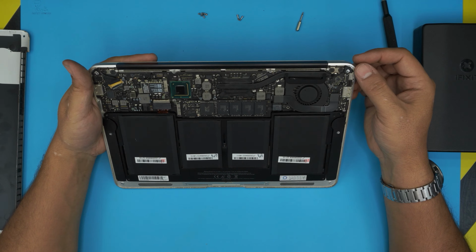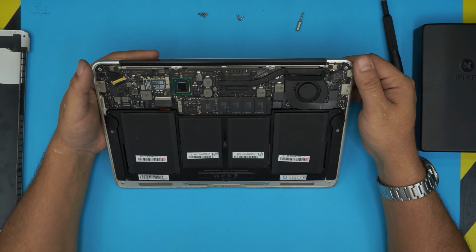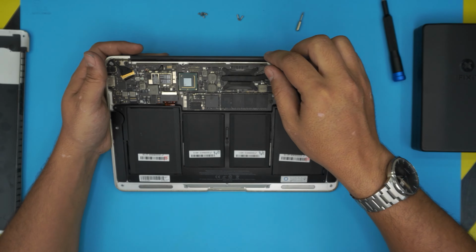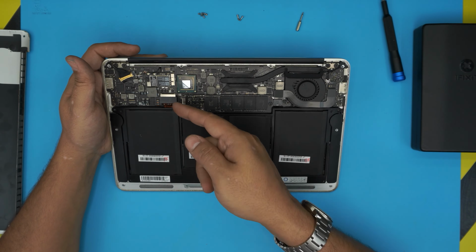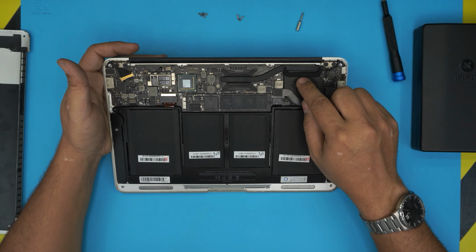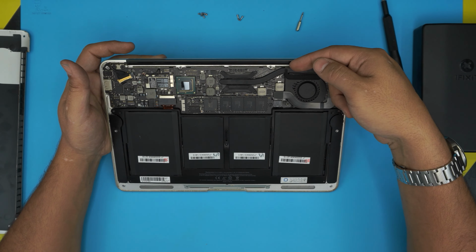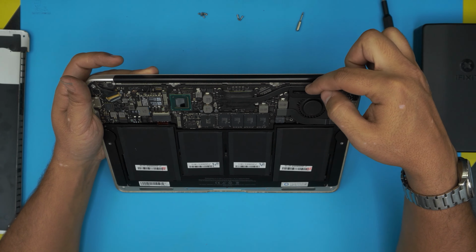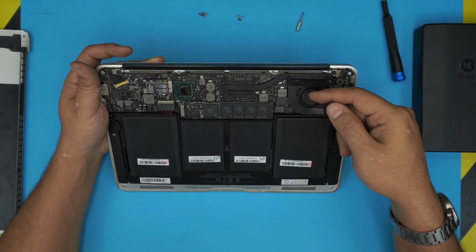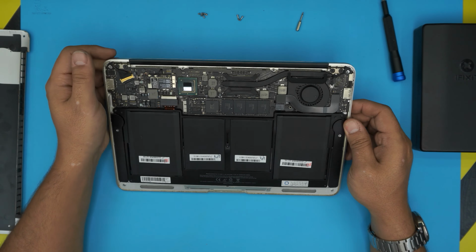Also, if you want to take a moment and clean it up, I made other videos on how to repaste and how to clean it up. Check my channel for different videos. But if you want to just clean it up, disconnect the battery, use a toothbrush, start cleaning, clean the fan, make sure the fan is really nice and clean. Use the air pressure to put in air from here so it can pull the air this way out.